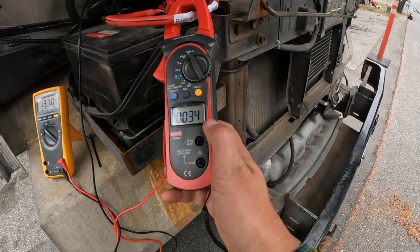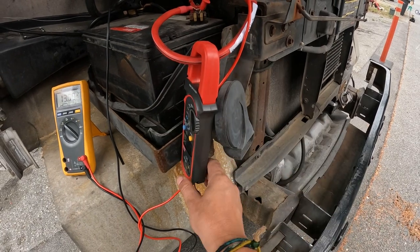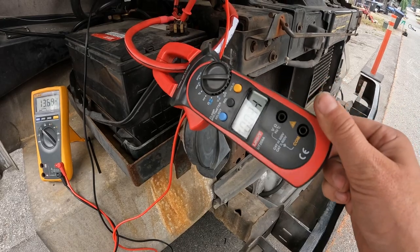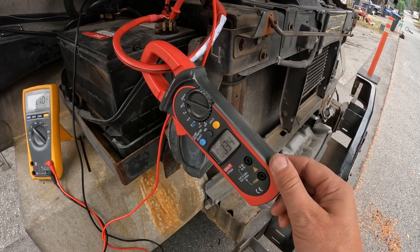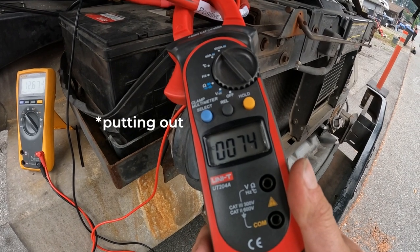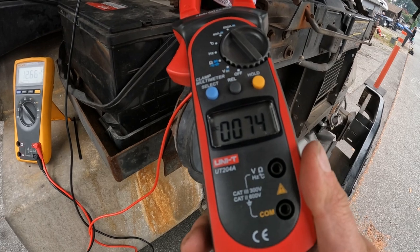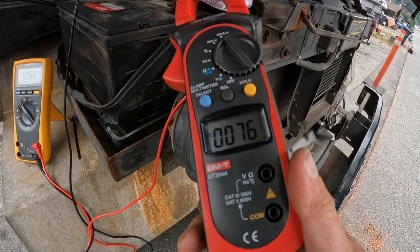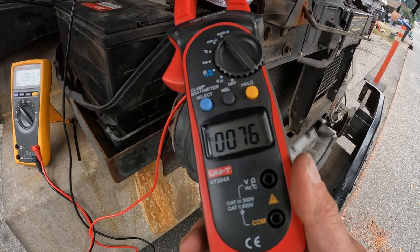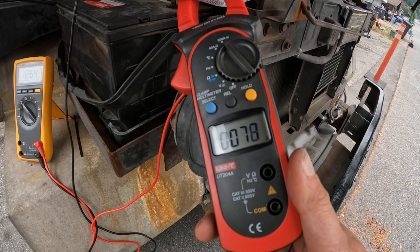It's not dropping. Yeah. It's staying the same. That's interesting. So it's 34 out here, and then from the alternator, and then 28 by the time it reaches the other end of the cable. That's not too big a loss. This is what the alternator is drawing. If we have it on a 60 amp charging, to get 55 at the other end of the cable. The rest is losses to resistance for the length of the cable. Yeah.